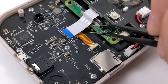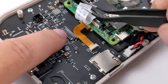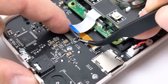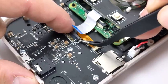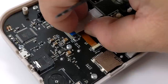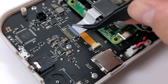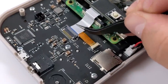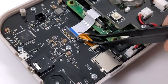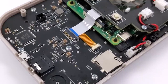Now we'll move to the very last ribbon cable. This one uses a different, push-style connector — when it's pushed in, it's locked, so you may need to unlock it first. You really don't need tweezers for this one; just grab it and slide it right in. Once it's locked down, you'll have about a millimeter of the blue still showing. As you can see, we still have a little bit of blue peeking out, and both cables are locked down, so we're good to go.